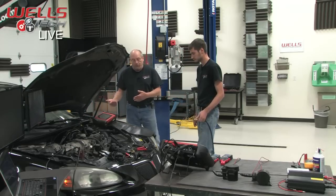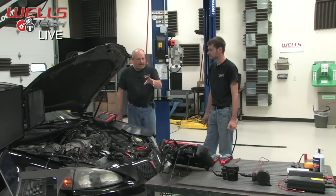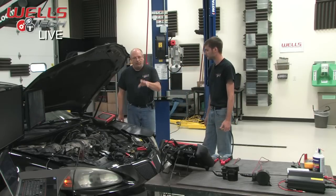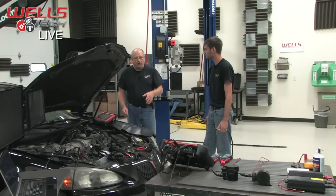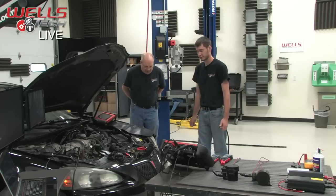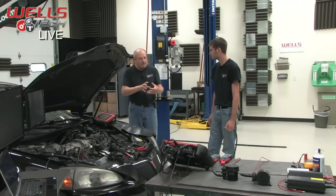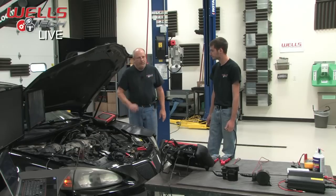Now, if we didn't see smoke coming out, the next step would be to either use that cap that we showed you to go back in the other direction, or to disconnect the filler tube from the tank and go up that direction. Exactly, somehow to get around that check valve. A very common failure on these is where the plastic insert goes into the steel tube, and they get rust in between there and start leaking, and it's a tough one to find.